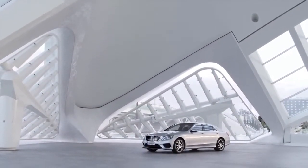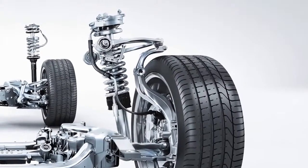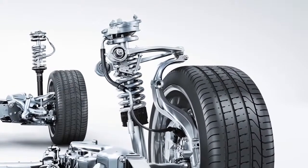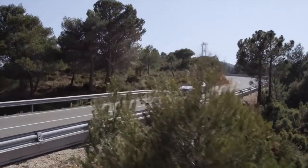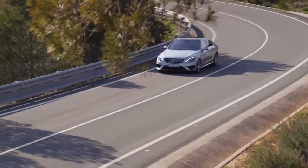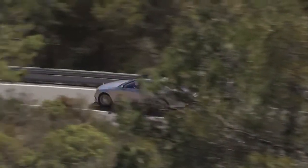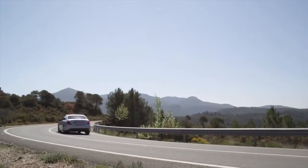The S63 is a full-size ultra-luxury vehicle that's also a performance vehicle. You want to carve the asphalt, but you also know this is a full-on luxury vehicle. So we have active damping — a system of computer-controlled shock absorbers. Using data from the vehicle, including positioning, speed, and steering wheel angle, it can manipulate how stiff or soft the shocks are. Driving through undulating country roads, you have a beautiful lofty suspension that cushions everything. But when you want to get aggressive, all you have to do is drive aggressively and the car becomes as aggressive as you are.